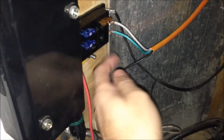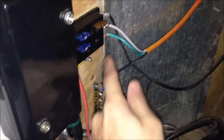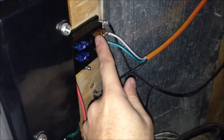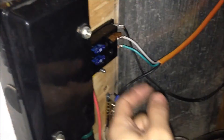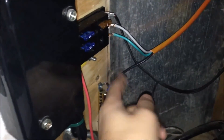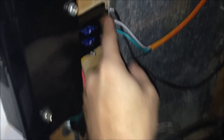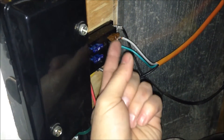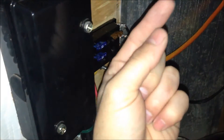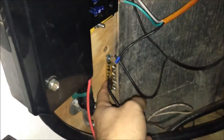Fuses, fuses, fuses — right now I've got some 15-amp fuses in my distribution block for the source. This is where my charge controller and batteries connect. This 5-amp fuse goes to the charge controller. I need to see if they even make a 4-amp fuse to match it. I've had this one blow before from moving things around, and it has saved my charge controller. Just like I predicted in a previous video, this 5-amp fuse blew first before the 4-amp fuse in the charge controller.